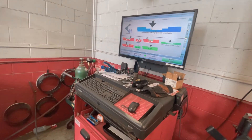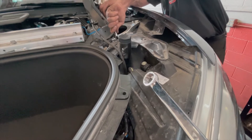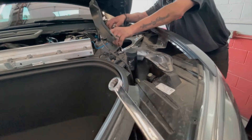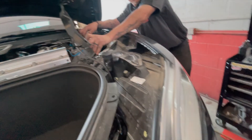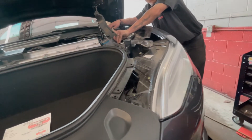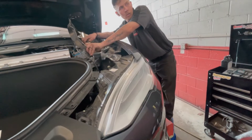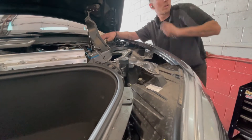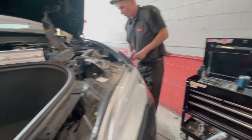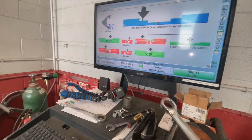It's just about maxed out. In summary, the front bolt is for caster and we can't adjust it any further to get within spec. We're going to try to do that up top first without touching anything down below, because we got this aligned a month ago when I put all the rear suspension on. Instead of having it maxed out, we backed it out a little bit so there's some thread on both sides for future adjustability. Then we're going to go adjust caster underneath.